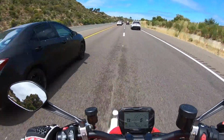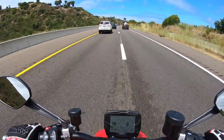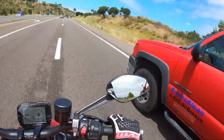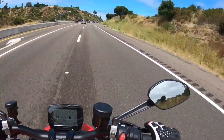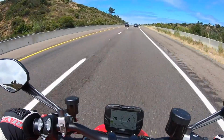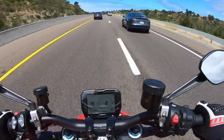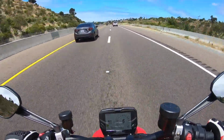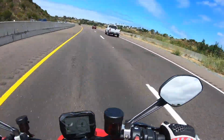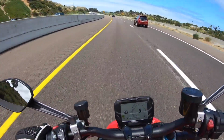Back to the engine. The engine on this bike is just insane. It is so powerful. The last time we dyno tested this engine in the Panigale V4, it produced 187 horsepower. And I wouldn't think this engine is far behind it. This engine does feel a lot smoother and more well-fueled than the Panigale V4 S. These Ducati sport bikes notoriously always have poor fueling from the factory due to EPA noise or whatever. These engines always need a power commander or a flash to get them running right.